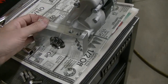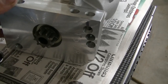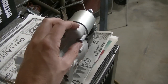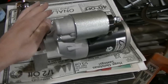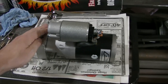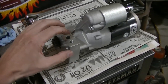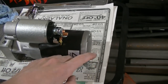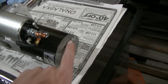One other thing with these mini starters is you can clock these things. You can see there's a few different holes there, and there's three bolts on this plate so you can clock this starter. We can rotate it up a little bit and get it away from the header tube, which is what I'm going to do right now. Another reason I wanted to make this video is because we had problems with the first starter. The directions tell you to take the bolts out of the starter and take it apart - well, do not do that because we snapped one of these bolts right here.